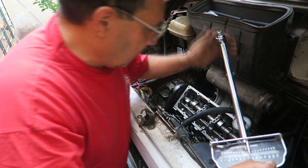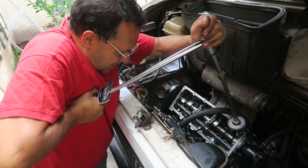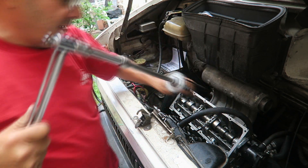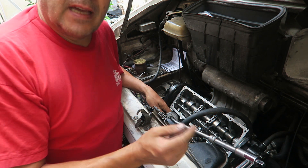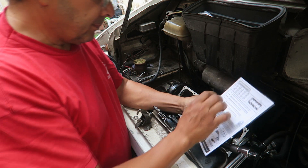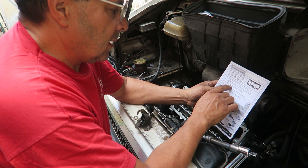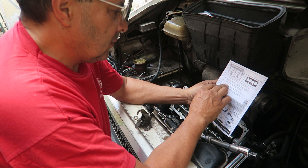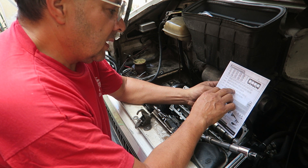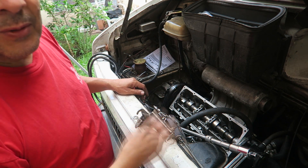Here you have to be patient and do things carefully. Back to zero, regulating zero. 90 degrees on bolts 4, 9, 10, and 11. Now we have to repeat the process. The third stage — angular tightening of fixing bolts 1 to 10, 90 degrees. And the fourth stage — apply the angular tightening again, another 90 degrees. So we go back for another 90 degrees.